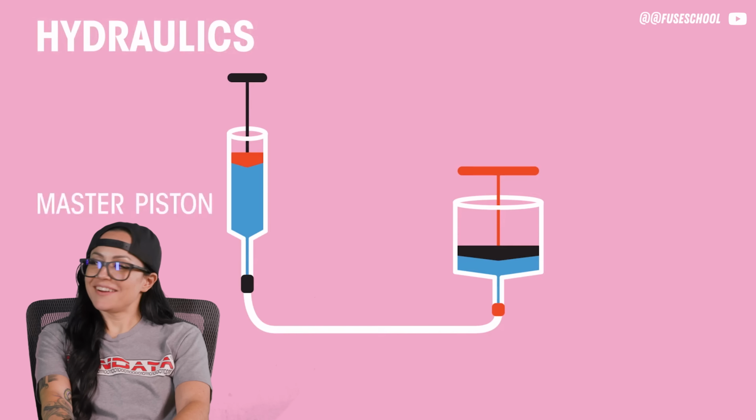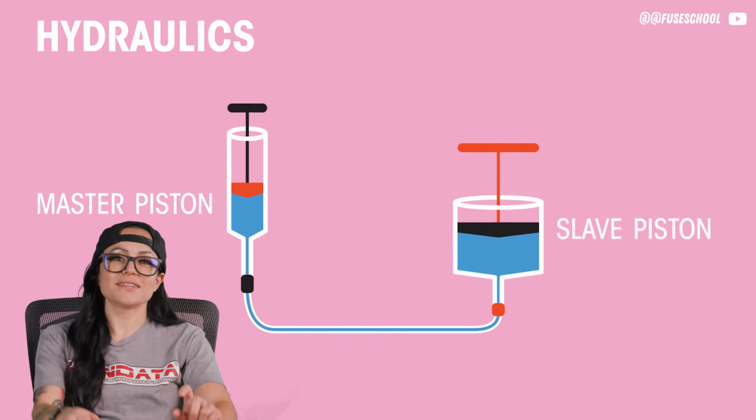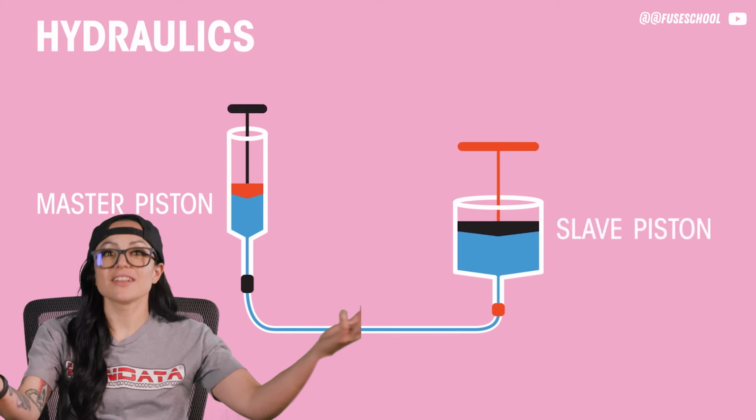Love it. You have one with a car jack. Yeah, I mean, a car jack is hydraulic. It works off of the hydraulics principle, right? Where we've got pistons inside and there's fluid moving, and we got one small piston, one big piston. We're getting hydraulic advantage. He's still using the hydraulic system. It's a hydraulic press that's big.